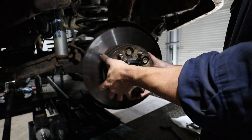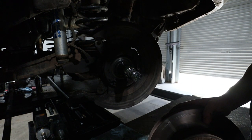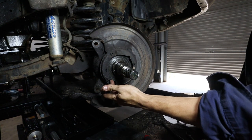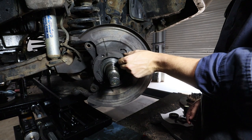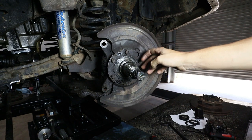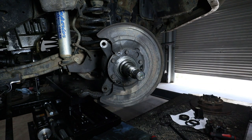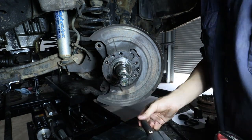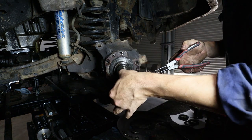We pull back and remove the whole brake rotor. The wheel bearing sits inside the brake rotor. Now we've got three little 10mm screws — I'd recommend using a 10mm socket rather than a Phillips head. There are six bolts holding the baffle plate and the knuckle spindle. Once we remove those and take out the circlips, we can remove the spindle and get back to the knuckle. These are 14 millimeter. There's also a circlip on the front that retains the CV.